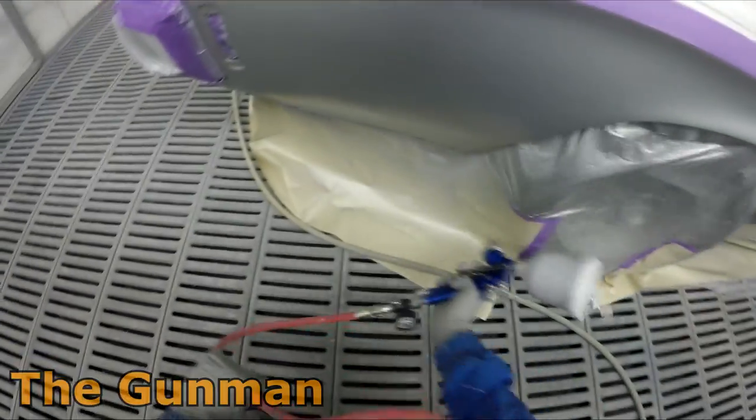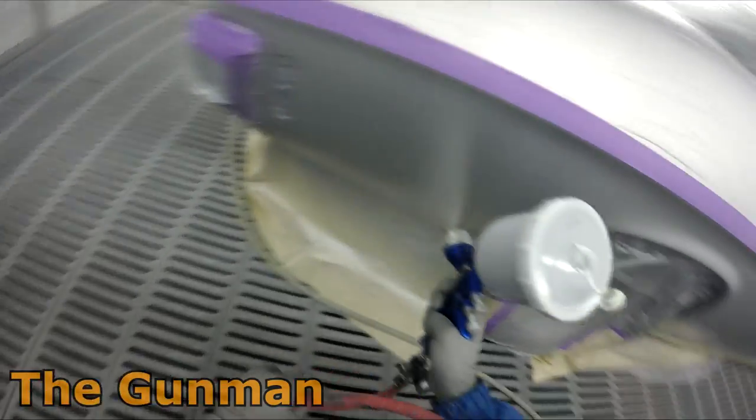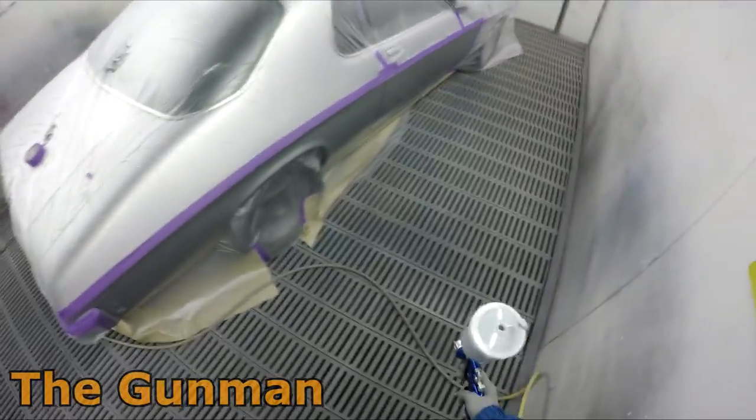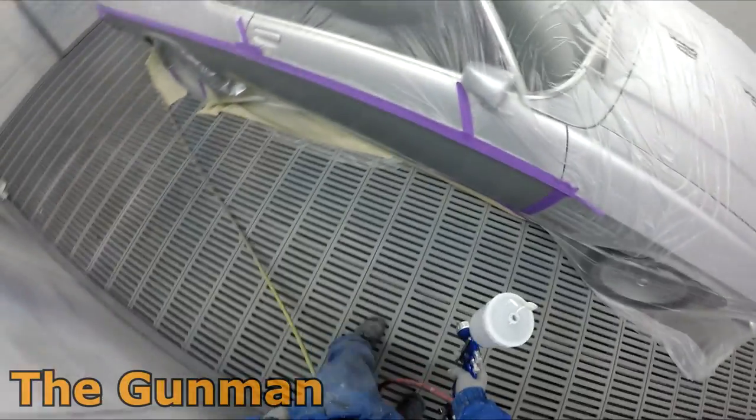You can also do the same thing with water. You can trap the water inside a waterborne job. So yeah, you can blow it down, think it's dry. It looks dry and it has skinned over the top, but it's sort of like a puddle where the top layer is dry. Underneath, it's just this big pool of water.